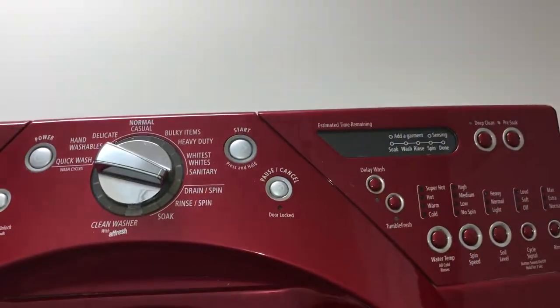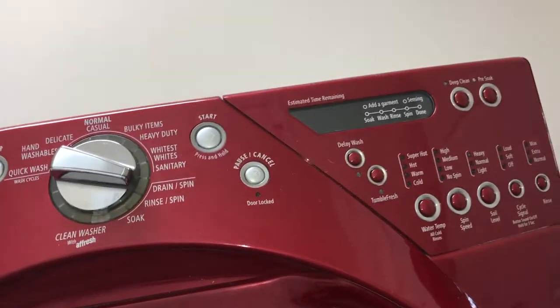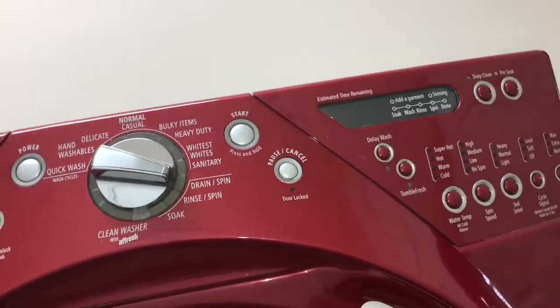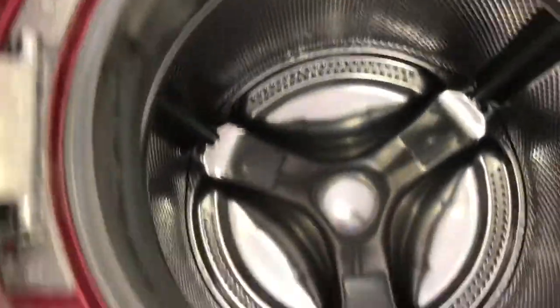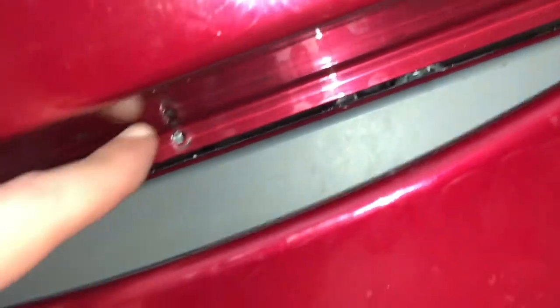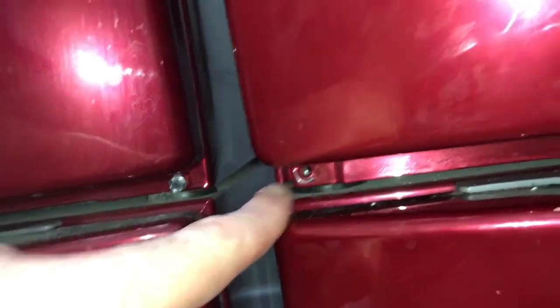The F21 code is going to be flashing yellow or green depending on what unit you have. Mine is 11 years old — a Whirlpool Duet front loader. You probably have water in here; you're going to want to suck that out with a shop vac. Then get to the front — three screws, one, two, three — and this thing just basically pops right out.